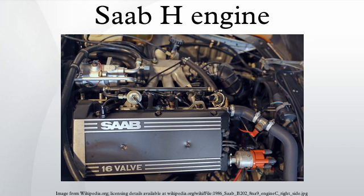There are two generations of B234 engine: one made from 1990 to 1993, the other from 1994 to 1998. The later motors had a revised oil sump system, head, timing cover, and different bell housing pattern. Unlike the previous B202, the block was no longer angled but straight, something that made it unsuitable for the 900 model with its gearbox under the engine built into the engine oil sump. The longer stroke B234 was last produced in 1998, that being the last year for the 9000 model. The B234 was selected as one of Ward's ten best engines for 1995 and 1996.